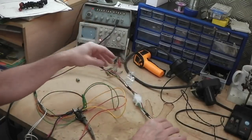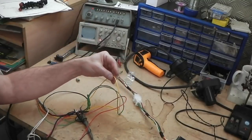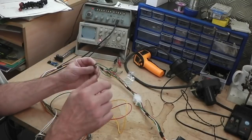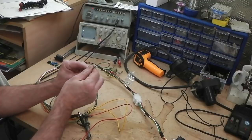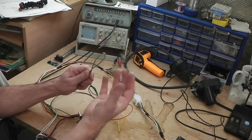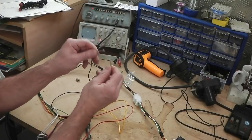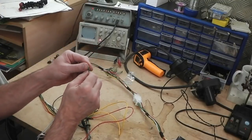And this looks like there's loads, but there's not. The yellow wire there is the speed sensor input. A pair of greens, that's that string of switches we talked about. That'll go through the drive switch, and that'll go through the brake relay. So when I press the brake relay, it'll disconnect them two wires, as will the drive switch. And that, as you can see, kills the circuit.